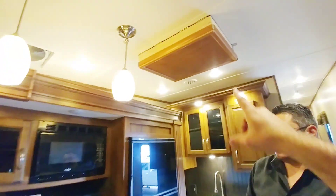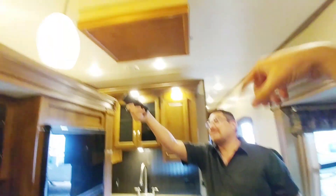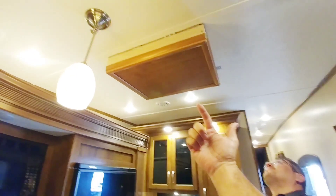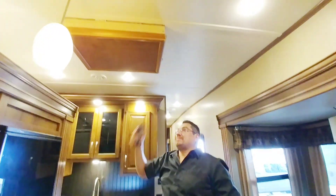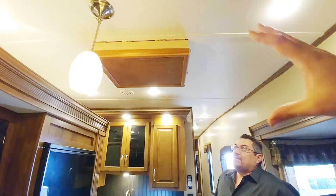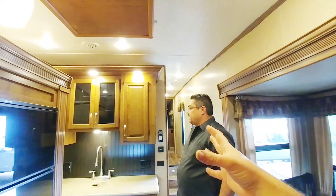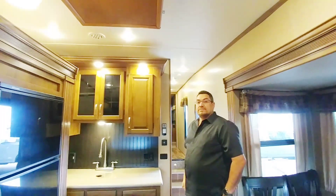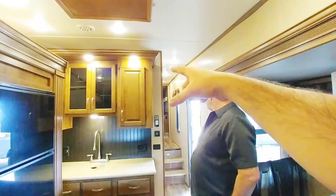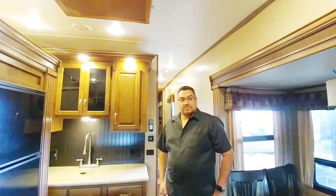One thing real quick — up top here, this is the baffle box, and I reinstalled it. This essentially quiets down the air conditioner quite a bit. It draws air in from that side and really reduces the amount of sound that the air conditioner makes, because air conditioners in RVs can be really loud. The rear air conditioner is fully ducted throughout the entire RV. The front air conditioner is the direct fire air conditioner, which blows down just into the master bedroom. What I've told people: if you're out and it's incredibly hot, get a fan, set it in the hallway, turn your master bedroom air conditioner on, and just have the fan kind of move the air through here — it helps out tremendously.